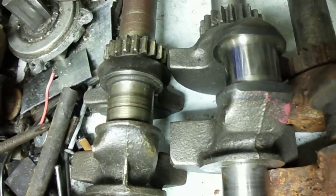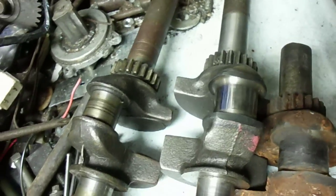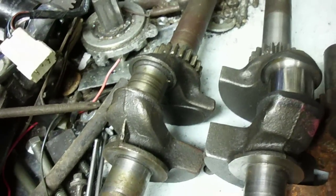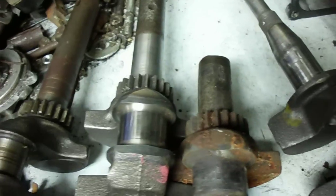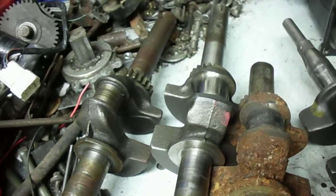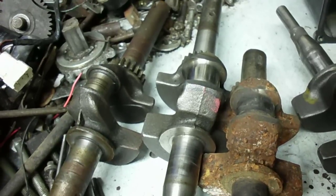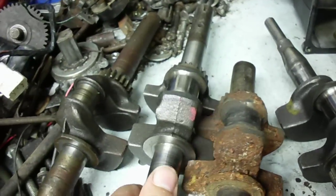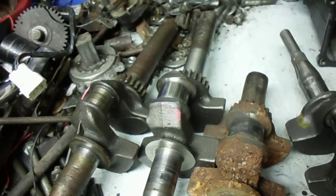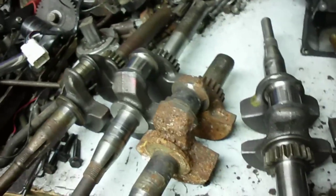Compare it to the next one — see the difference in size between the crank journals. These crankshafts have an induction-hardened crank pin, which helps with longevity and toughness. To my knowledge they're made of ductile iron, which is kind of halfway between cast iron and steel. It has good vibration-absorbing properties, and if you hit it, it reacts more like steel — it doesn't shatter like cast iron.